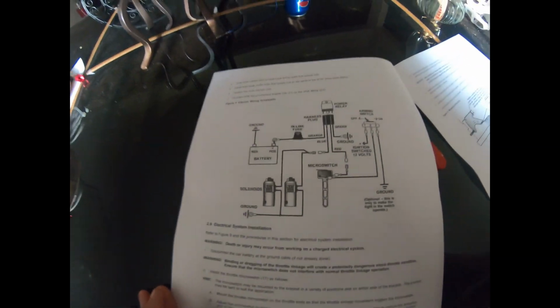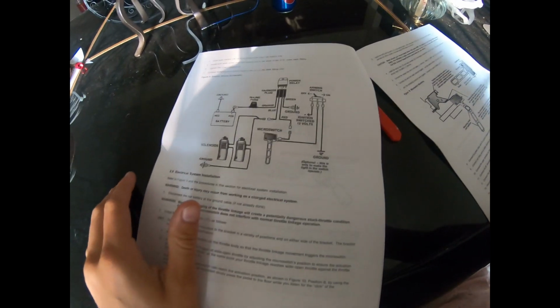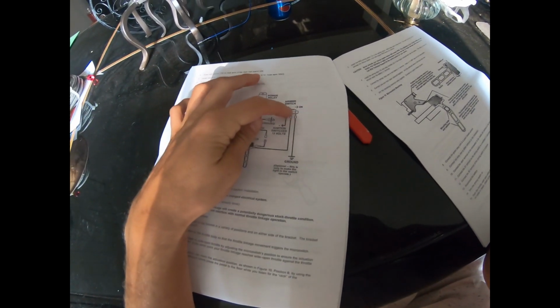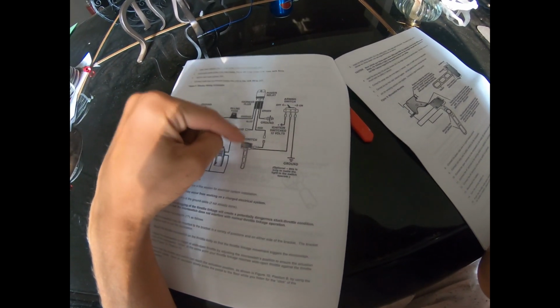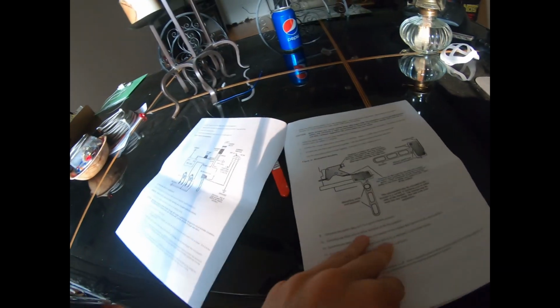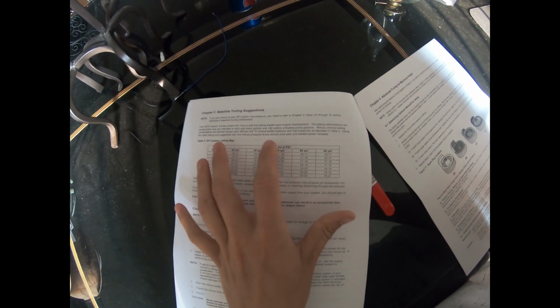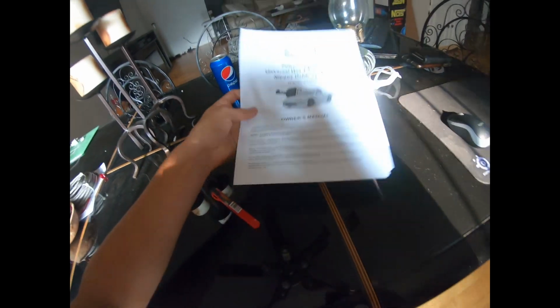There's your wire diagram right here. This is the basic wiring setup you have. Then you have a switch that goes to the micro switch. This switch arms basically the whole system here. It lets power go to the switch so that when you hit it, it turns everything on here and activates nitrous. There's like a jetting map, so it tells you what fuel jet to use at what PSI of fuel. I just gave you like the basics of that. There's not really too much in there.